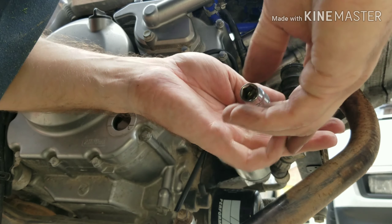This entire job should take you probably not more than five to ten minutes. It's probably a little bit longer when you're recording, but I can usually change these things out really quick. Same with automotive — I love working on trucks because the starters are right there, whereas with cars it's all buried inside. It's easy work. Just remember: don't over-crank the 8 millimeter bolts, you don't need to get crazy on any of them. Take your time with it — you really can't screw it up. Thanks for watching this video. Please like, share, comment, subscribe, and I'll see you guys in the next video.